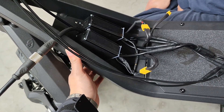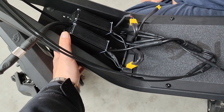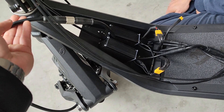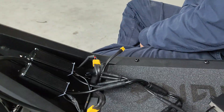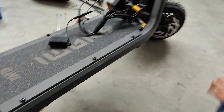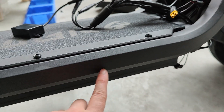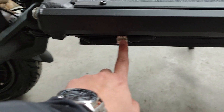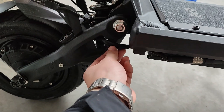As you release the bolts, the controller is able to be detached from the plate. For the front motor cable, it's hung up here with the cover and rubber. For the rear motor cable, it goes through the frame — between the section of the frame and the battery box — and connects here for the motor for easy detachment. The light cable is also here.